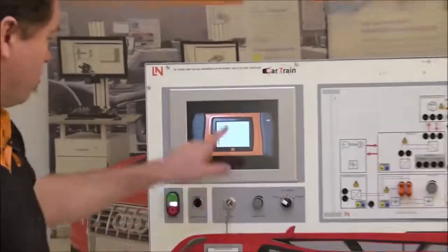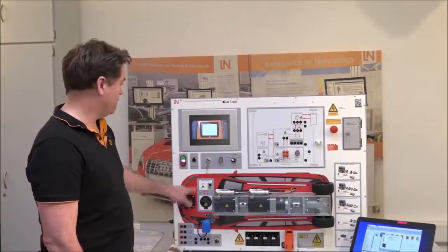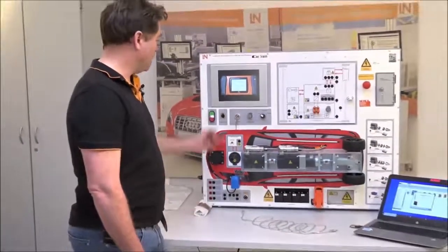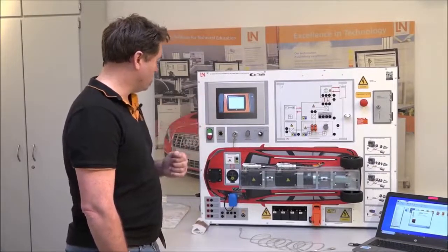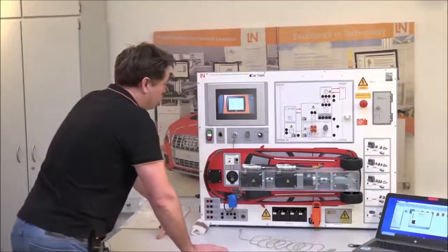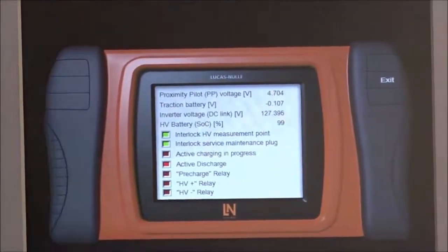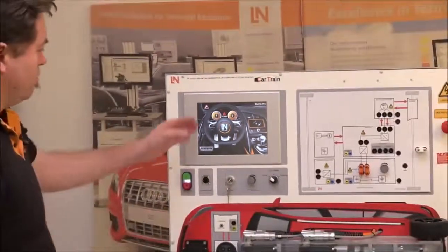You can also see the proximity pilot (PP) voltage within the charger — currently 4.7V, which will change when a cable is connected. Indicator lights show that the interlock is okay for the high voltage measurement point and the service maintenance plug. Removing a service plug quickly demonstrates that the interlock at the service plug is interrupted, which generates a fault.